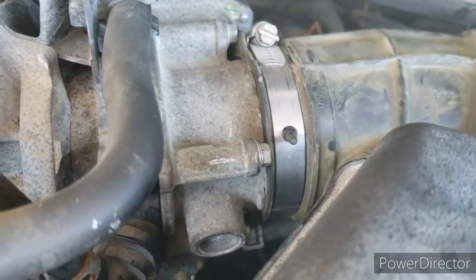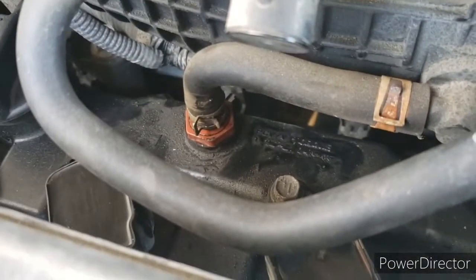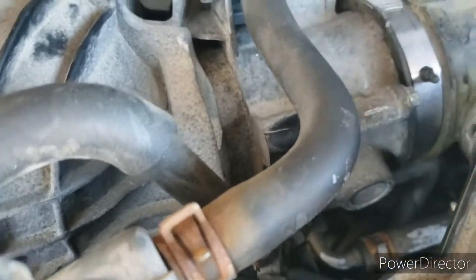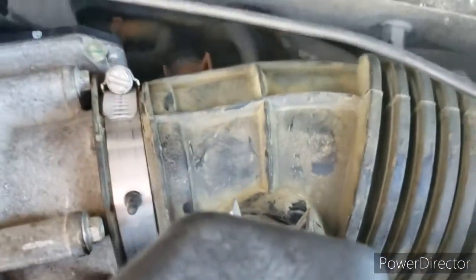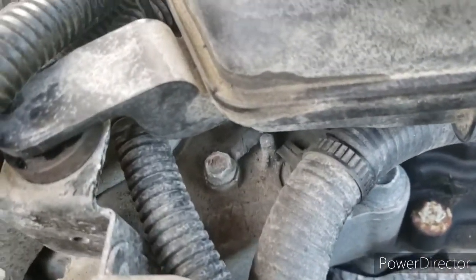She's kind of rough idling and the PCV valve is good — I can't find any vacuum leaks. So I'm going to take off this throttle body. You need to take off your resonator, whatever this is.